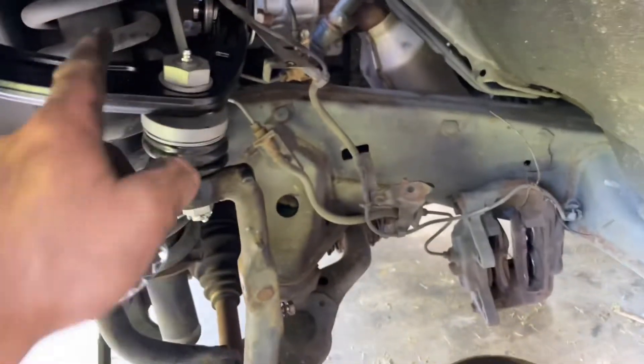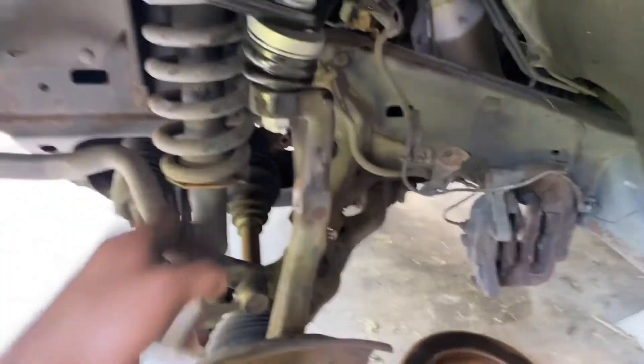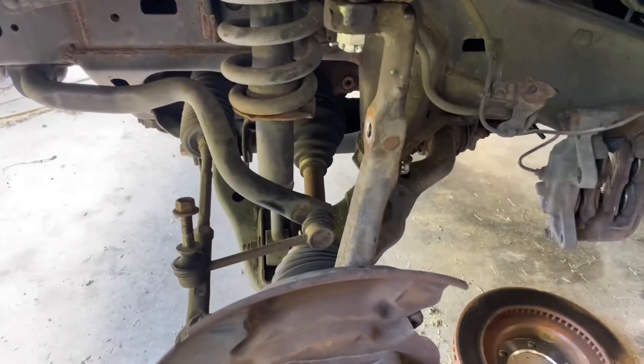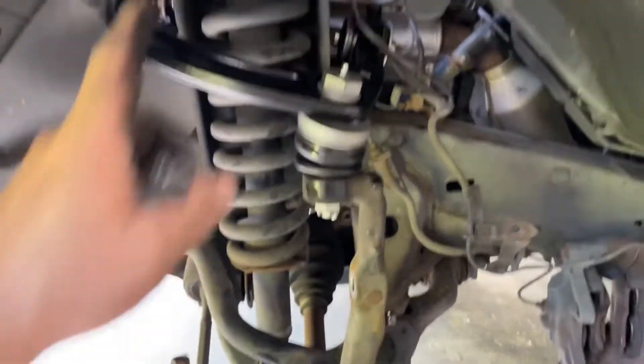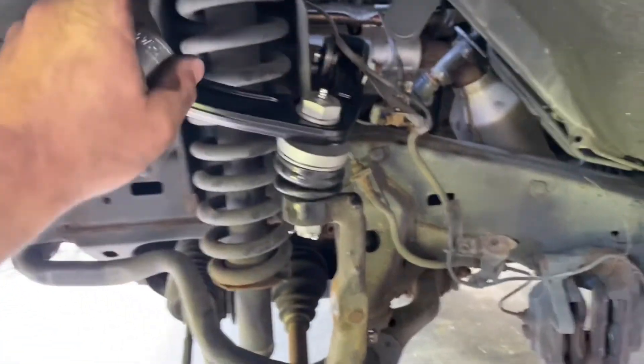I'm going to go ahead and grease this and tighten it up but not all the way, since I'm transferring it to my tire shop. Once the Dobbinsons lift is in, they can fine-tune the alignment. If you're putting a full three-inch lift in the front and want full clearance, get the SPC upper control arms — they'll make your life a lot easier. You'll get the clearance you need and be able to properly set caster and camber for a correct alignment. The OEM Lexus upper control arm just won't fit correctly with a three-inch lift.